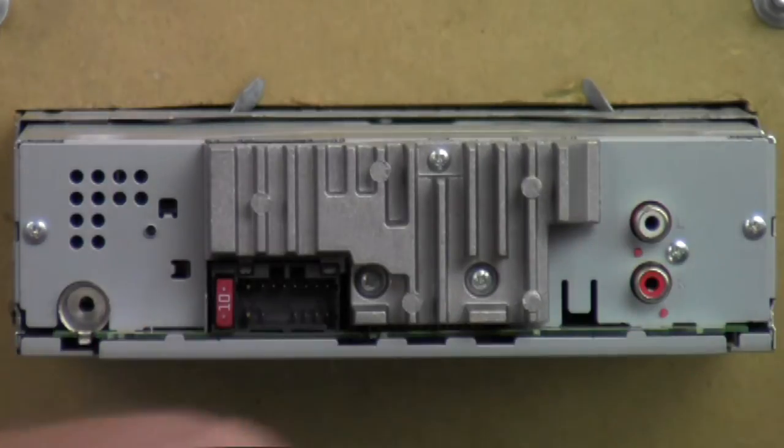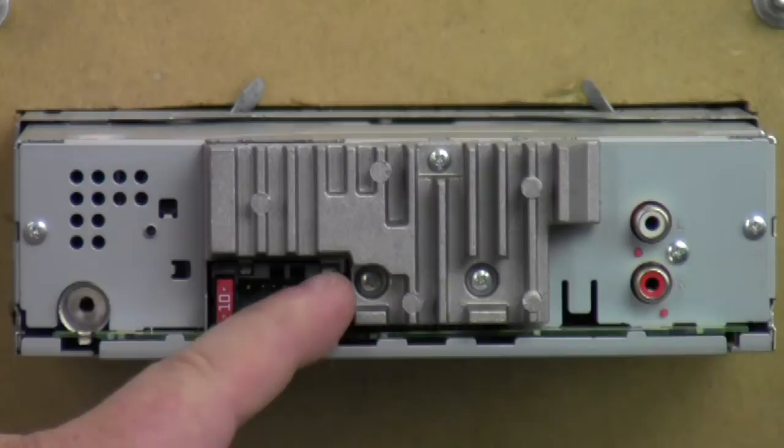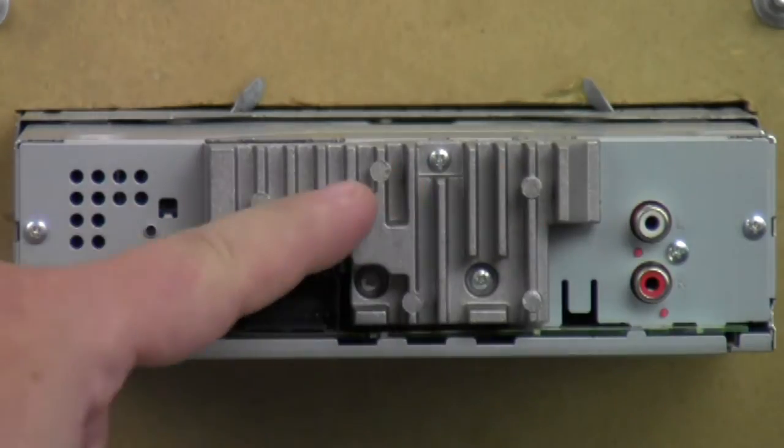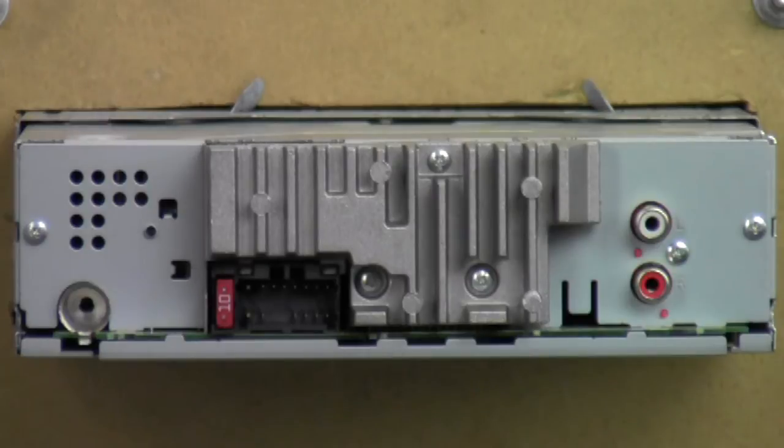We'll start from this side and work our way to the right. The first thing to see right here is the antenna — this is what you plug in to catch FM stations. If you have a newer vehicle, you might need an antenna adapter. Here's the power plug section socket with the 10-amp fuse. Got a little heat sink right here. Looks like we got a rear slash subwoofer preout — that's just two volts — so you can play some bass like a monoblock amp, or put a two-channel amp on there for some highs. You got some RCA outputs for that. Pretty basic back there, but it's still got all your basic needs.